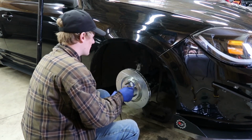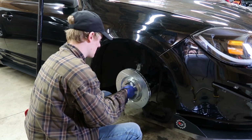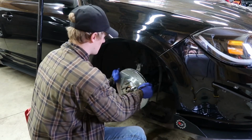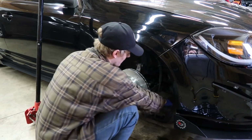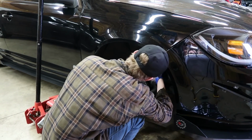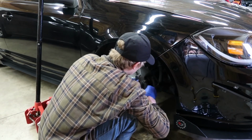And we'll start working on the brakes. It's gonna be the hardest part, so I gotta compress those. Come on. Alright, that's not really loose. It's a lot beefier than the other one, but yeah. That one's gonna go right back on. Gotta compress those pistons. Find a way to do that. Oh, I just compressed them with my hands.